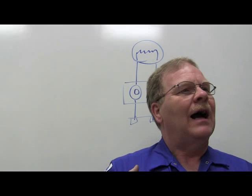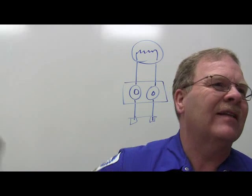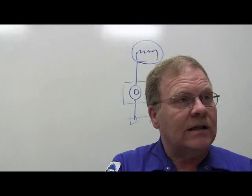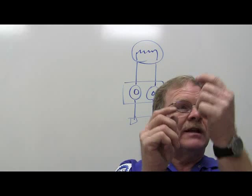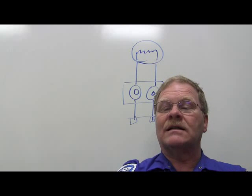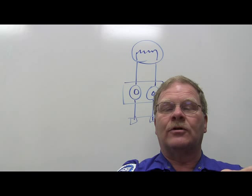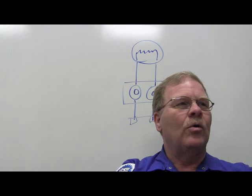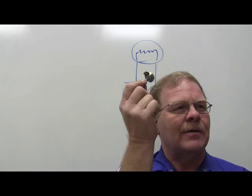Okay, what good is that? Well, I'm going to say, I wonder if the cooling fan will come on this car, and you don't have time to let it warm up for the fan to kick on. So I'm going to crank the car up, unplug the engine coolant sensor, and hook these two wires coming off of this, and I've done it with jumper wires, into the engine coolant sensor. I watch my scan tool, and I turn it real slow, and I get it up to the temperature where the fan is supposed to come on, and the fan will kick on. It's still cold here, but it thinks it's hot because you're manipulating the voltage with this potentiometer.